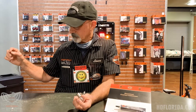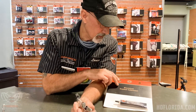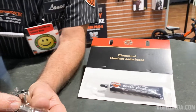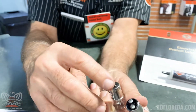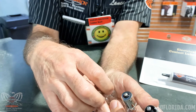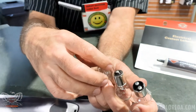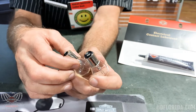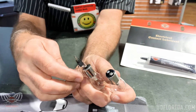Clean them off when you get them installed into your lamps. One of the things you also want to do is use dielectric grease, also known as electrical contact lubricant. You want to put it on the ground contact and you can also put it on the positive — it won't draw enough electricity to cause any issues, but it will help stop oxidation so that it remains clean and you always have a good contact with your bulbs.